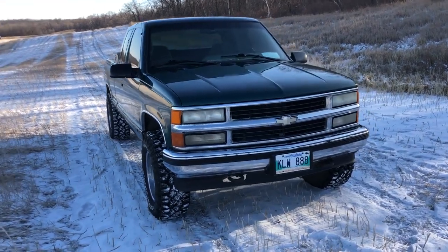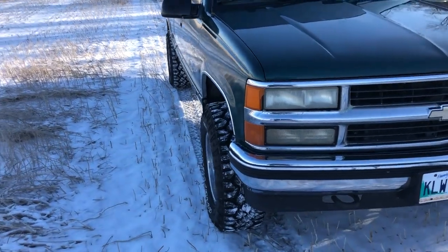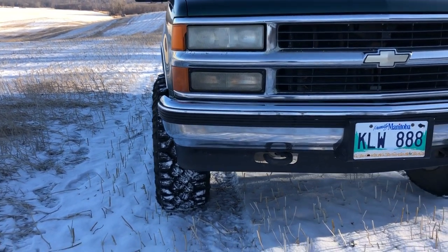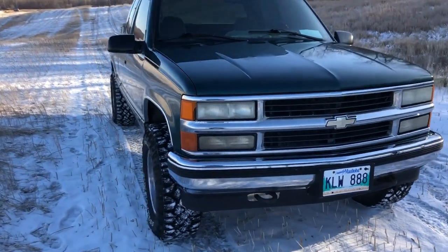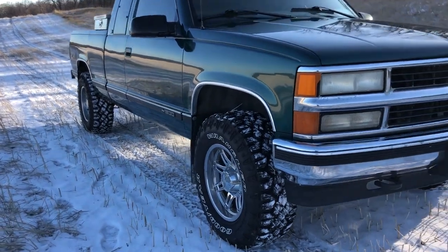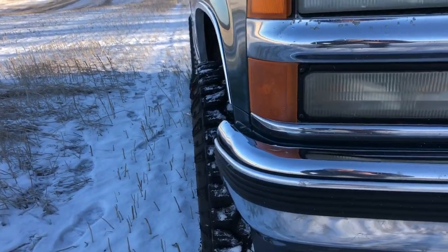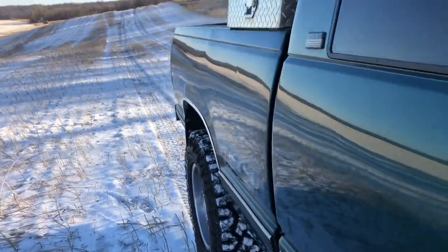I'll show you guys a few different angles so you have an idea what it fits like. These are 285/70/17 Goodyear Dura Tracs on a 17x9 wheel — I think it's around a plus one offset. So nothing crazy on the stance, just a bit more than factory, which is basically what I wanted. I use this truck for work, I'm on gravel all the time, so I don't need 12-wides or anything. And it's leveled, so you're kind of limited on how wide you go. I think it looks pretty good in the front — these trucks have a nice taper. In the back, everything's kept in the wheel well pretty nice.